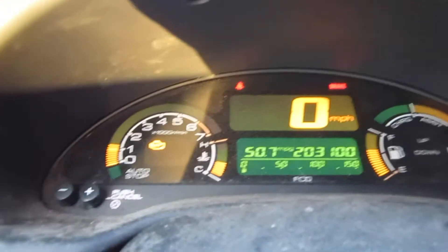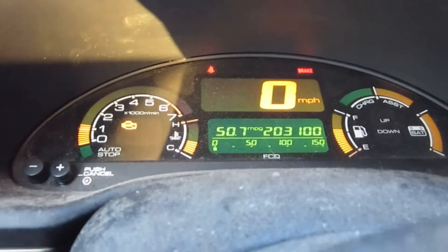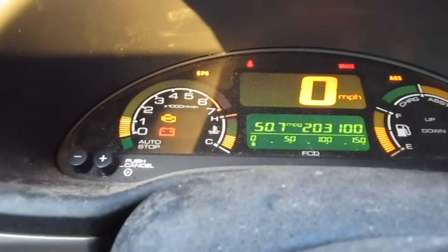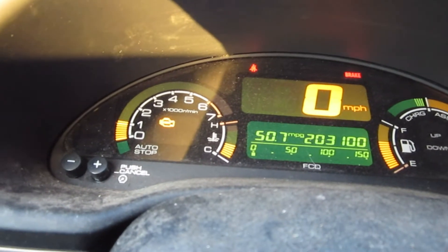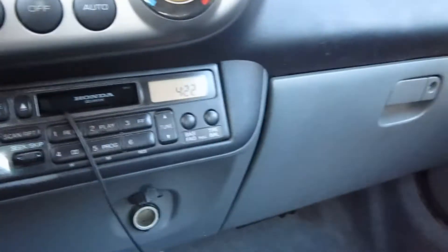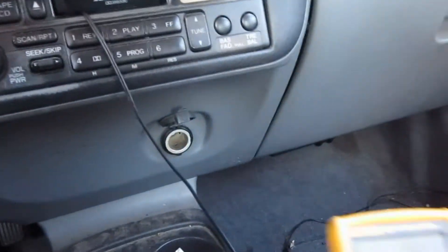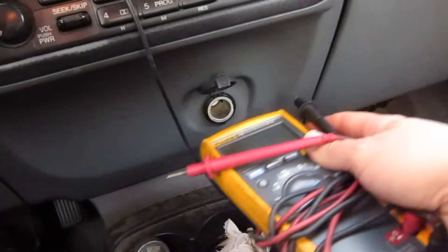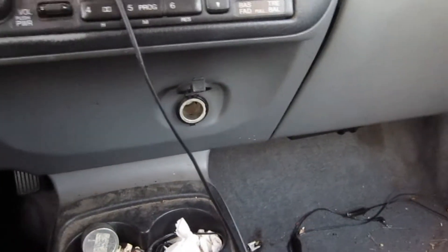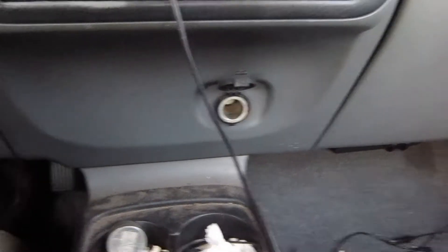Of course the brake light is on right now. So I could be running it around, and the battery light will come on and stay on because it's not charging properly. I'll get out my voltmeter because when it's charging, you take your voltmeter and you measure the battery voltage. I can measure it through here. It should be over 13 volts when it's charging properly, and when it's not, it goes down to 12-something or lower.